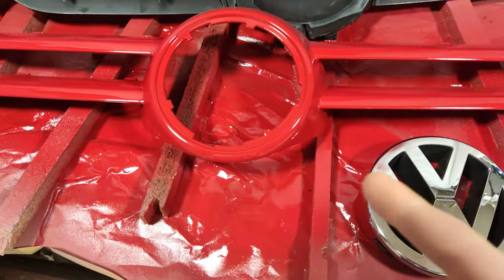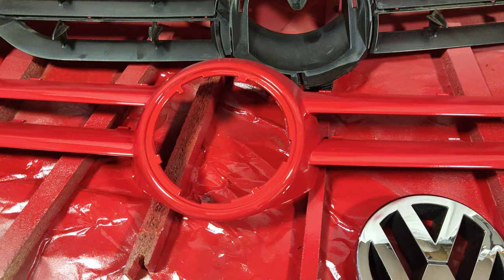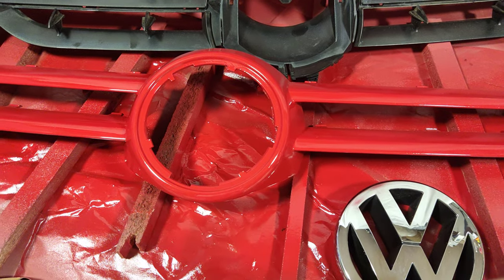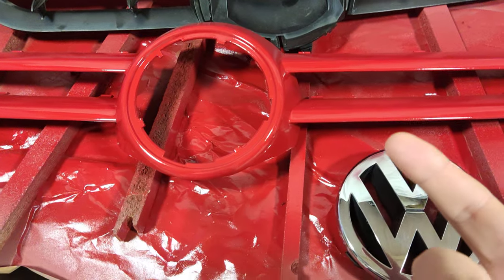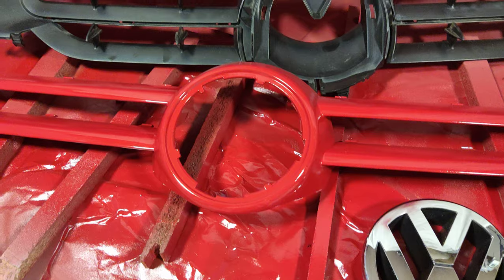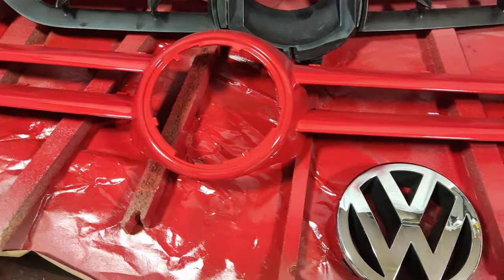With the clear coat, I gave the top coat of red, waited about 20-25 minutes, then applied another coat. I gave that about 30 minutes and didn't touch it at all because the finish was good. Then I applied the clear coat on top of that.